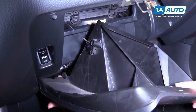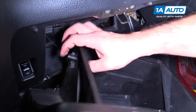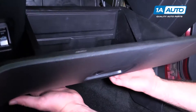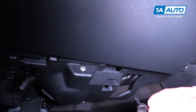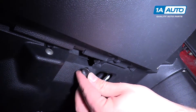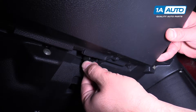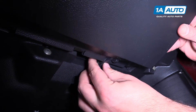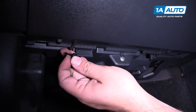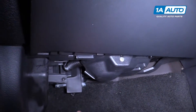Now, those hinges — you can see there's a hinge here; it's going to slide in between those two, there's one on each side. I'm going to slide the holding tabs into place, get one in, get the other one in, so the glove box will sort of sit there. Get it lined up where the hinges go. Now we need to take our hinge pins and push them into place — they're going to go in from this direction. Get that one all the way through and line it up with the glove box. I've got one; I'm going to get the other one. You can actually lift the glove box up a little bit if it's easier. The glove box now hinges.